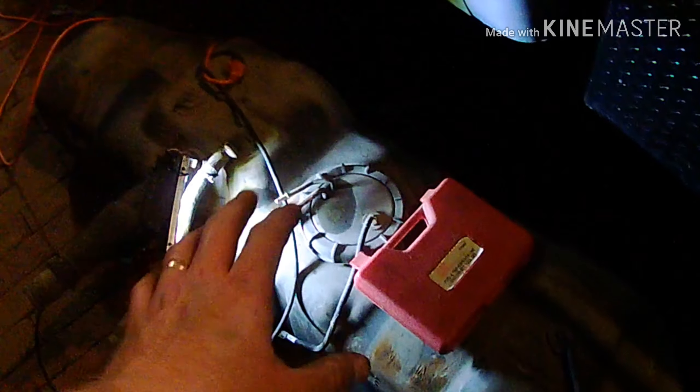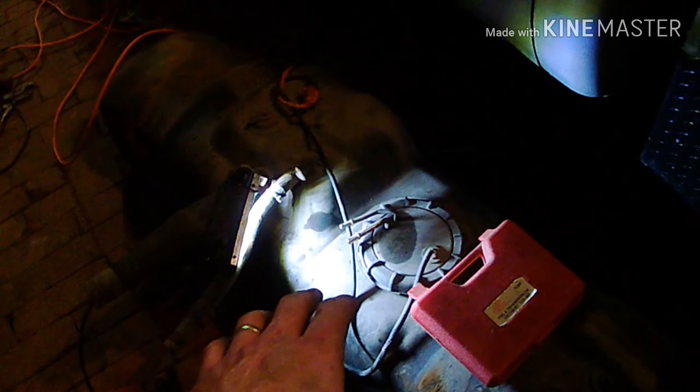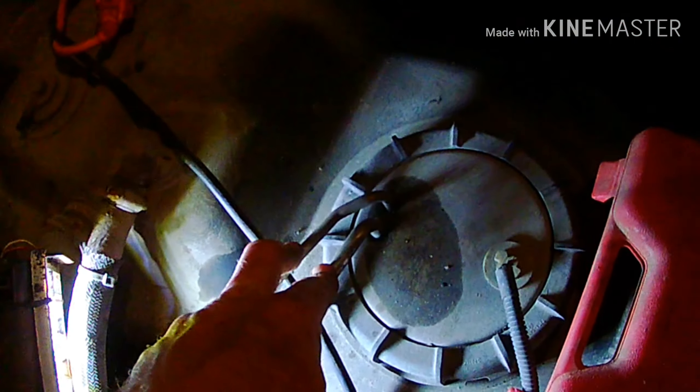I went ahead and got the gas tank out. I ran this almost completely to fumes pulling into the garage, so I'm pretty much only dealing with the tank. I'd really recommend running as low as possible. You have your fuel sending unit wiring and plugs, two fuel wires, and a filler neck. I have a flatbed so yours will be different with a standard bed — get those off, it's fairly easy. I also have a vent tube here and another one here.